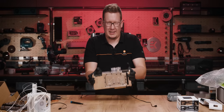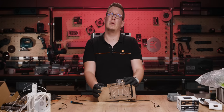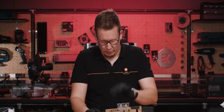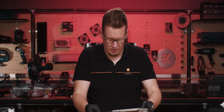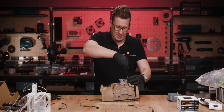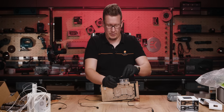Since I don't want the active backplate, I'm going to be attempting a full parallel loop — well, not fully parallel, but parallel from the GPU to the radiator. My colleagues left the active backplate on from yesterday's recording, which is neat because I don't have to install the GPU block, but I do have to remove the active backplate.